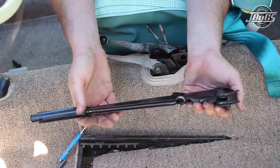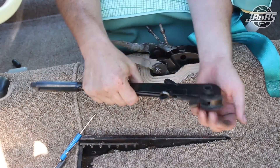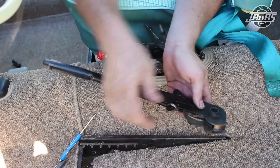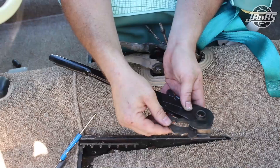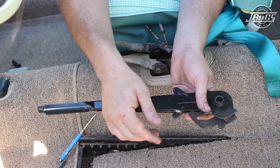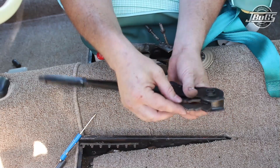With the emergency brake or parking brake handle out, we can see that it doesn't actually need to be replaced — more so just reset. This is very common. What happens when you pull the emergency brake up too far is the actual mechanism will flip around and reset. In this case, it's been lodged as well.